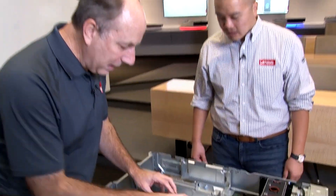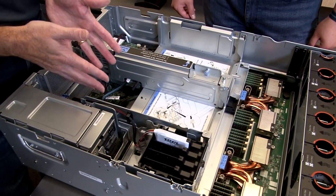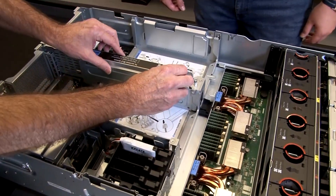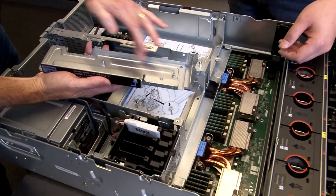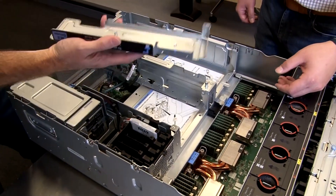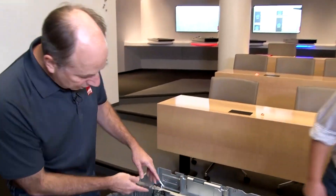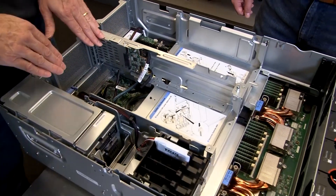On top is the space for four super caps — these are the power modules that connect to the RAID controllers in the server. They sit in that space to maximize the cooling coming in from the front. This is also the area where if you wanted to use M.2, the M.2 would be mounted on these mount points and connected. You use that instead of the 7mm drives as your OS boot drives. This supports an adapter that can have one or two M.2 cards if you use those for boot.